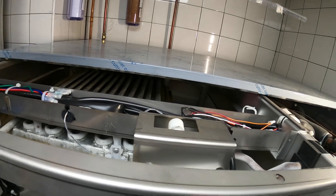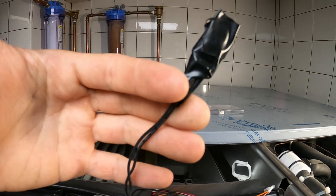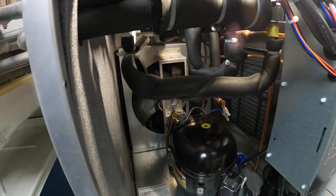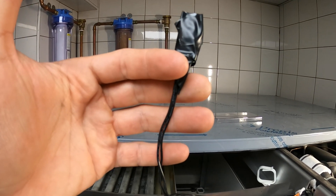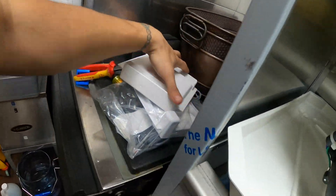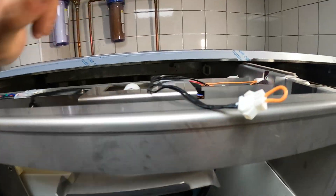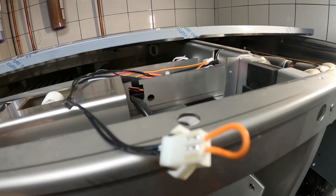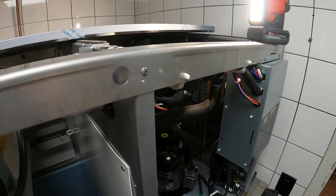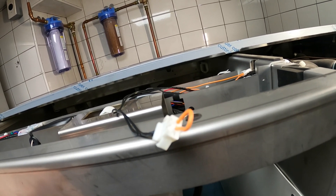I took off the tape and tie wraps. Here we have a bit of an electrical panel. These two wires — I basically put them together and that's what got this machine running. I bypassed the bin switch like this. There's a little clip here with a white connector. I didn't want to cut up the wires, so I took a piece of thermostat wire and put the two connections together — jumped it out, closed the circuit. That's how I got it going, but it's hot-wired because of that.